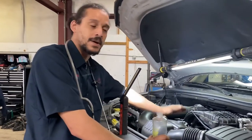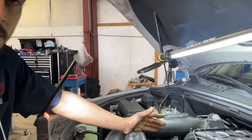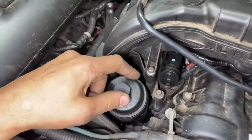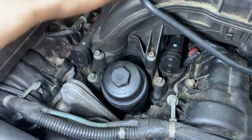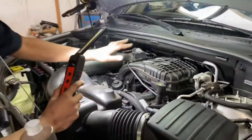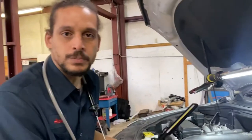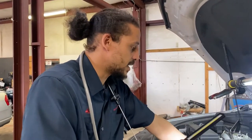I do know where the leak is coming from. Prior to the video, I put coolant in here with water because I knew it was going to leak out. Down in the engine valley, you have the oil cooler or oil filter housing — it's part of the oil cooler, tucked under all the intake. You have to remove the upper and lower intake to get to it, and it's completely ruptured — a big hole in it.